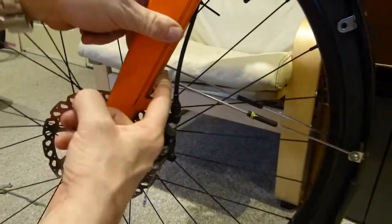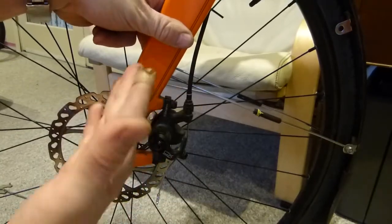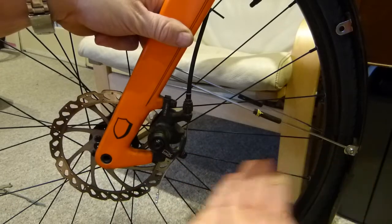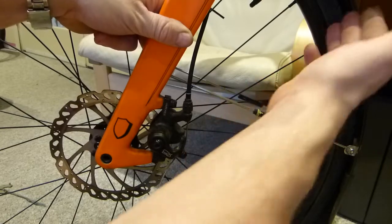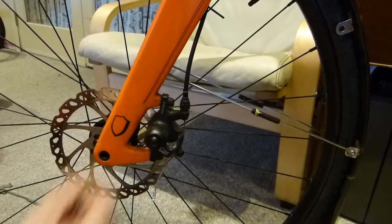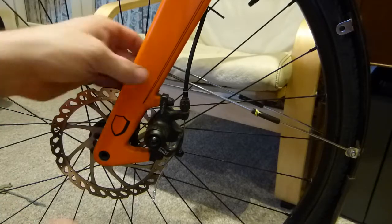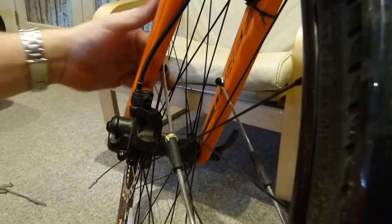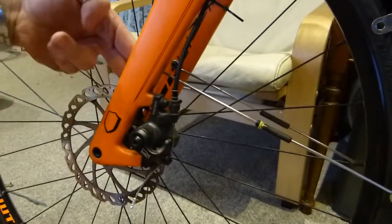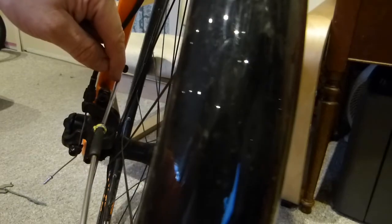You can see that the mounting point is somewhere above the brake. The manufacturer decided that on its fork leg there wouldn't be a mounting point for a fender further down to brace the fender, because one wire stay can be there, but the second one is really difficult because the brake caliper is in the way. So they moved a mounting point up above the brake rotor here. You can see from the inside that this bolt head is about two adult fingers' width above the brake disc - a generous clearance. There is also lots of clearance sideways to the nearest spoke.